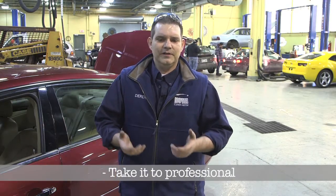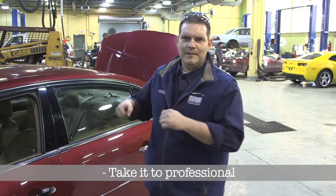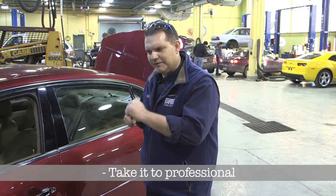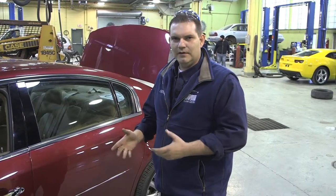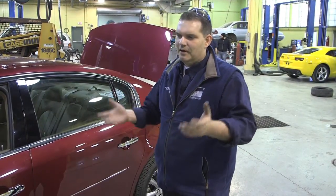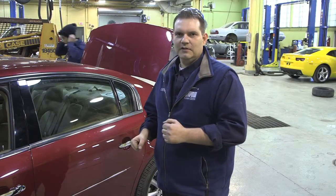One of the reasons I say that is because tightening the wheels on older cars used to mean you could really reef it down and tighten those lug nuts as tight as you want — it didn't matter. But today, the materials on the car are lighter and lighter, for handling reasons and fuel economy. Because they're so light, if you over-tighten the lug nuts, there is a danger that you could warp the disc behind it.